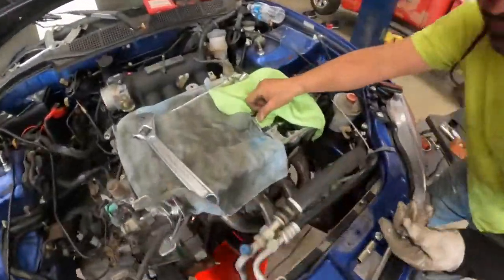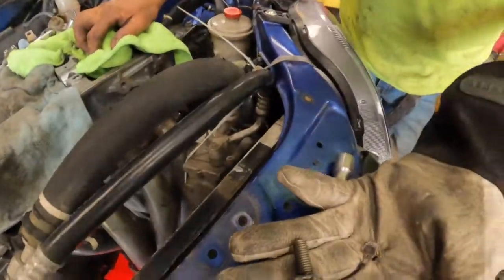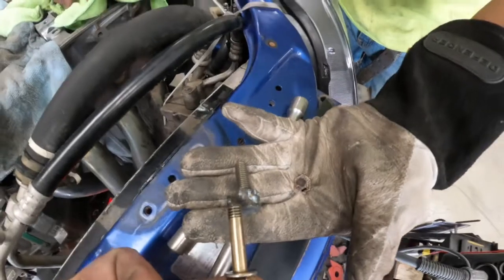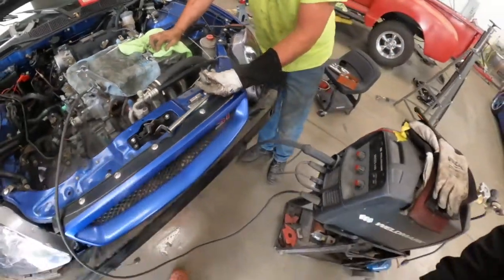Just like that, she came out. This is one of those not-quite-a-two-day-job situations. It's not always fun and games when you're building these engines — you don't know what other people have done. That one was still in there a good ways — that's how much was left — and that's our broken stud. Luckily the welder came in clutch and it came on out. Don't over-torque your stuff. Just don't do it.